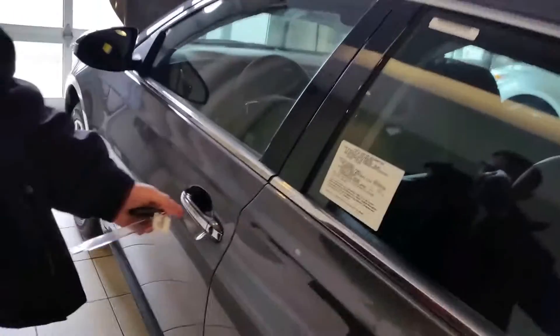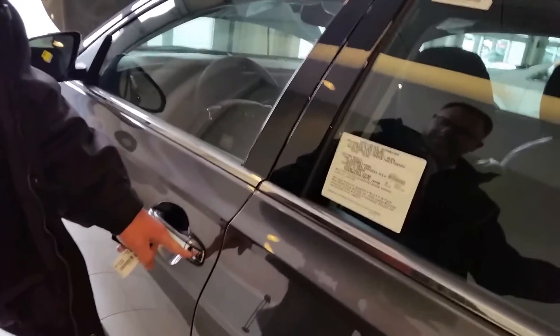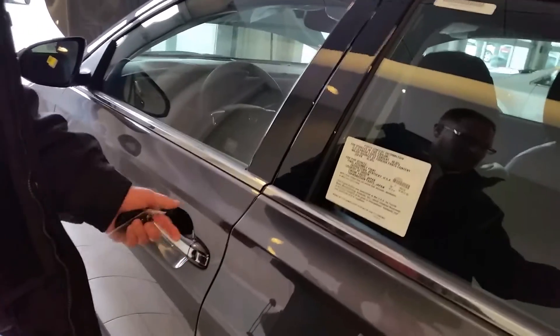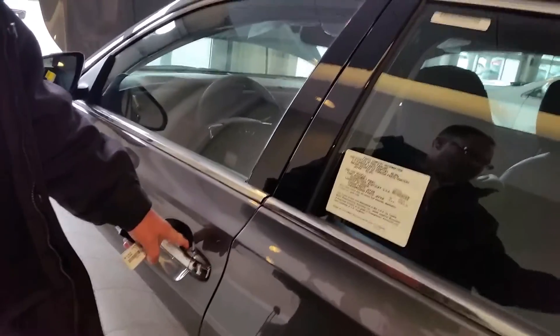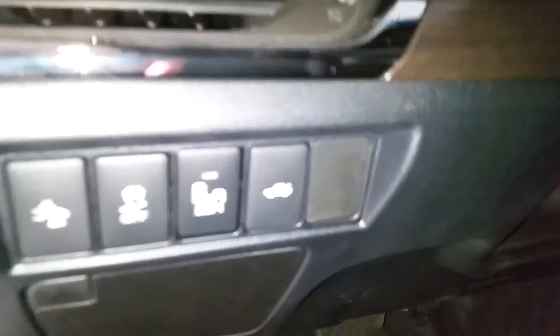You'll have to put the key into the door slot — that's the only keyhole you will find on the vehicle. Unlock the door first, because you will not be able to go to the trunk. If you have a dead battery, the trunk will not be able to be released because the electronics won't work, so the trunk release button won't be available to you.